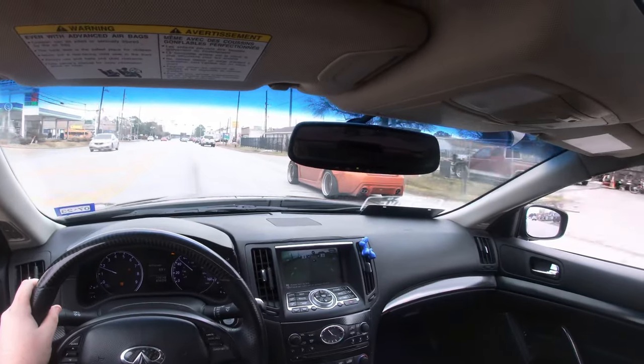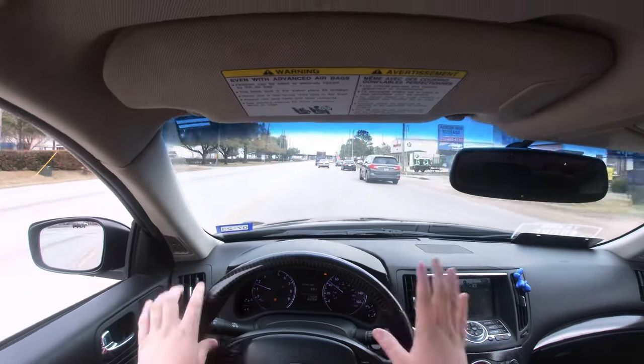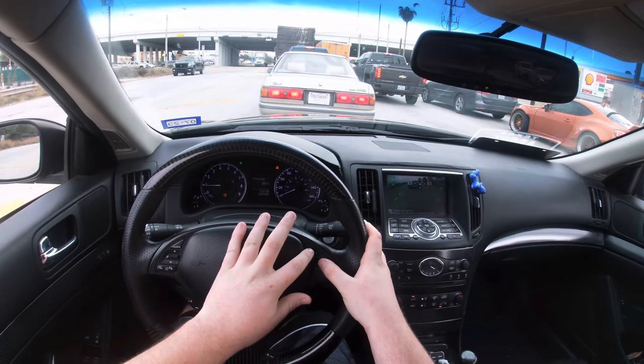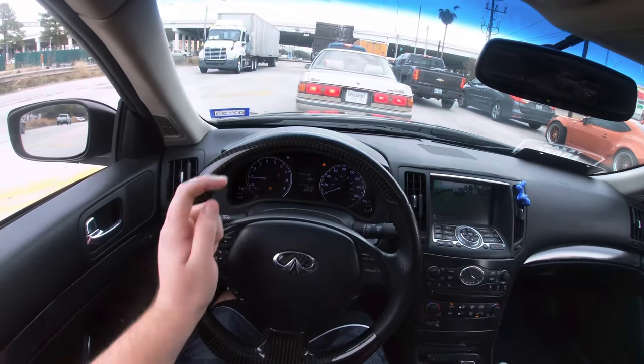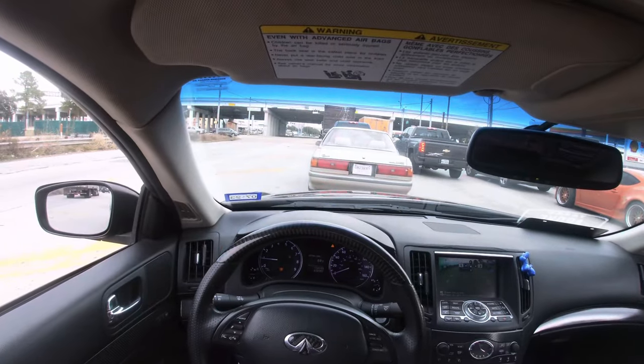They're probably wondering, why the hell do I have a damn GoPro on my forehead? This big blob on my forehead. Go ahead and switch into my map two. So I'm gonna hold down the accelerator, press cancel twice, let off, the set light's gonna flash twice on the dash, and now I am in map two.